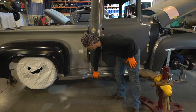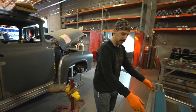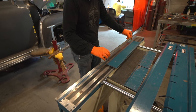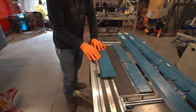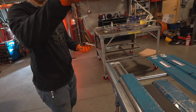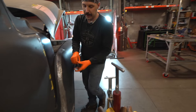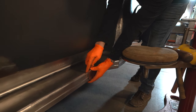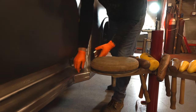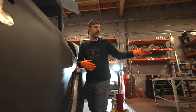So I made this all by hand, so I've gotten the top on the other side done. Now I'm hand making all of that right now. What I do is I take a piece of tubing on the magnetic brake. Luckily with the magnetic brake, you can put any steel material down and bend it and it'll contour around the radius. So once we get that, this is my template, so I'm just gonna replicate this onto here. Then I'll set up the bead roller to put this bead die in there, and then I'll hand hammer this radius edge over it. Then I'll hammer it some more so it gets to the shape perfectly, and then I'll weld that seam all the way around. I have to make all of these sections because I can't fit this large material in the brake or the shear.